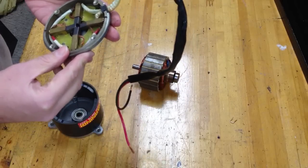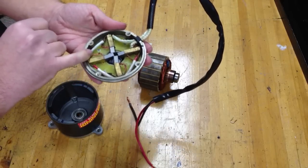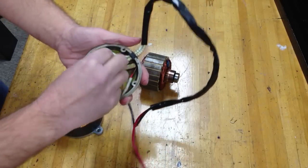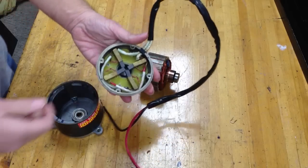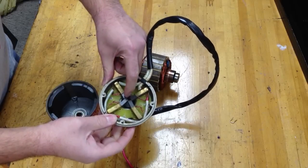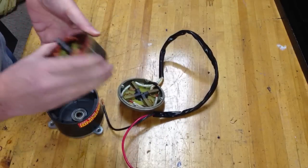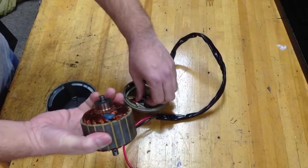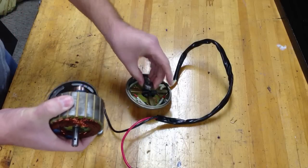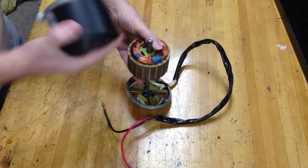This isn't easy to tear apart — they just pressed the metal down on the brush pad here. I'm not going to tear this apart yet, but the fun part is I can see now what's holding all the brushes back. Looks like probably the best way would be to hold the brushes back, keep the bearing on, drop the bearing inside, then slide this into the clear, let the brushes come back out, and put this over.